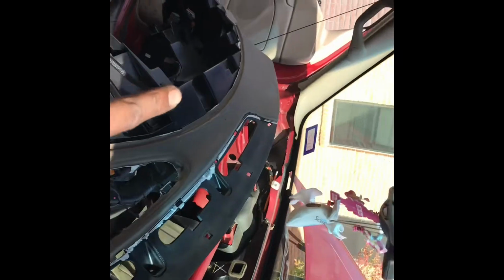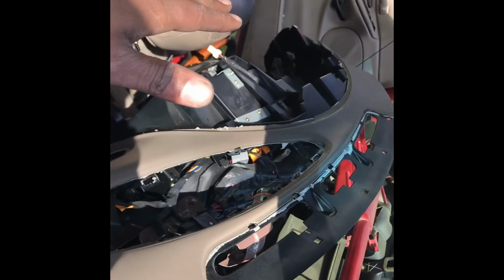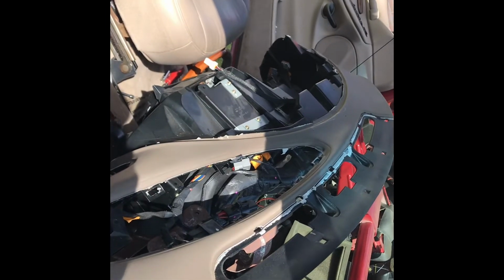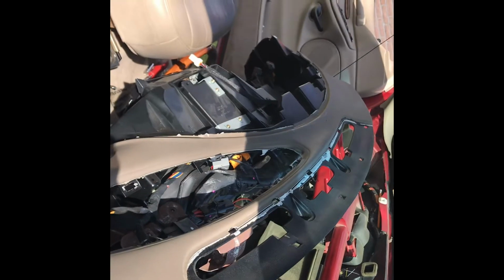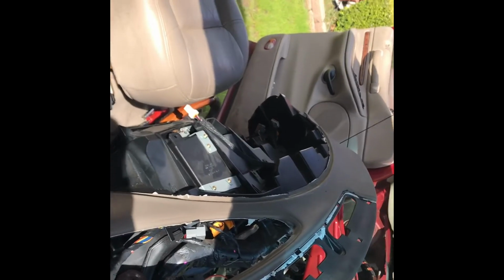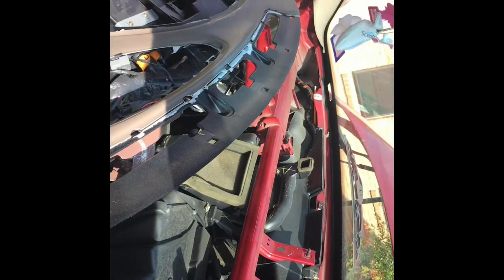And in this corner over here by the driver's side, there's like a fuse panel. Remove the fuse panel. Don't remove it from the car, but unbolt it. And then it's gonna be a struggle to push it through whatever it's mounted to. I'm tired at this point, but do that, and then it'll essentially just fall, hallelujah, right on you. You know what I'm saying?